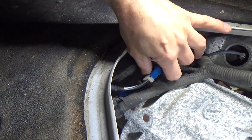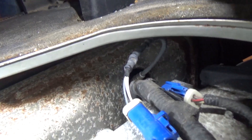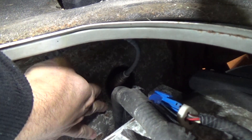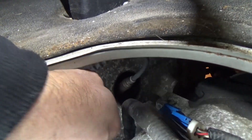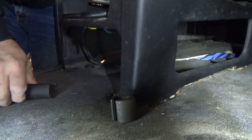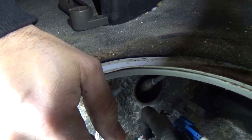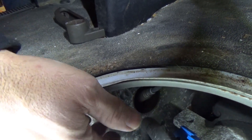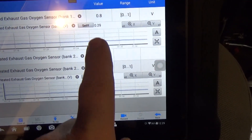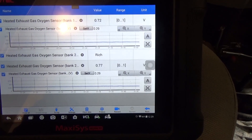Let me take you for a little joy ride. Here's our connector to the O2 sensor wiring. Follow it right down there — there's a heat shield around it, which makes it a little tricky to get to from below. I'm going to attempt to get it from the top. I think it's 22 millimeter, and I've got one of these O2 sensor socket tools. I'll spray a little PB Blaster down there and try to work it out. The new sensor is in.